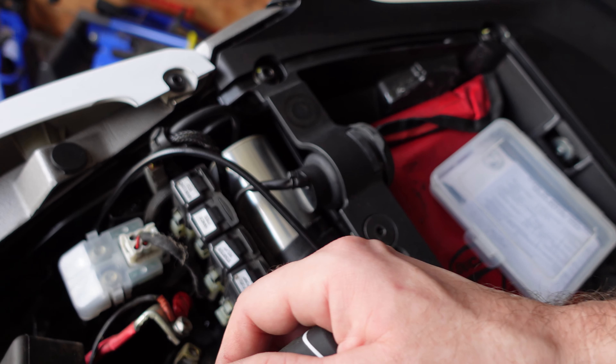One tip: if you have accessories hooked up with different fittings, leave the bolt in the terminals so it keeps all the terminals together. When getting this battery ready, we want to do two things. First, transfer the rubber backing plate from the old battery to the new one — it just peels off and goes on the new one. Second, put the little terminal backs in the battery. I like to put a piece of masking tape on them just to be sure they don't fall out. The battery comes with new hardware — new screws and backing plates — I'd recommend using them so oxidized metal doesn't cause issues with the electronics. Same with the terminals on your bike — go ahead and clean them up so when you attach the new battery you have good voltage.